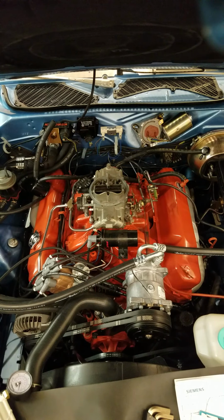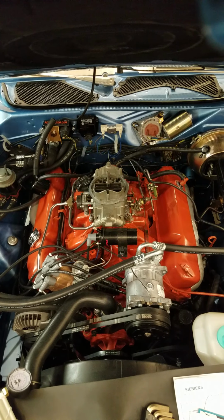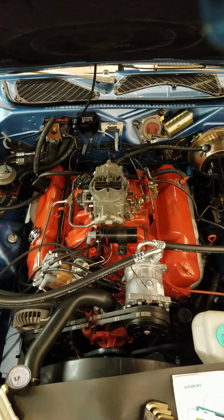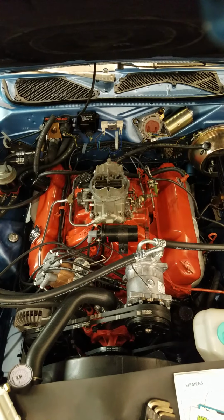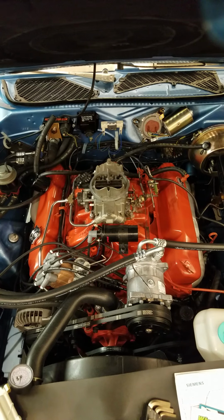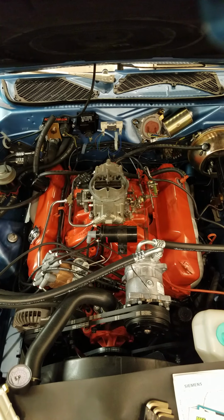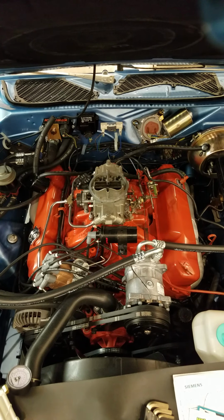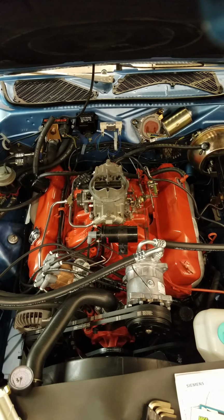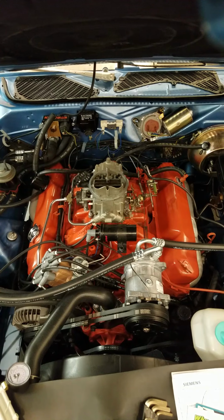So another thing is fuel wash. That's a big deal. Unburnt fuel, of course, gets into the cylinders and washes oil, therefore leading to increased wear on the rings and cylinder walls. Not to mention bearing life and all that stuff. One of the greatest things you'll notice is fouled plugs, right? A lot of us complain about that, having to change plugs super often. Another thing people don't consider is that exhaust valves can get to the point where you start burning valves and increased coolant temps, overheating, etc.